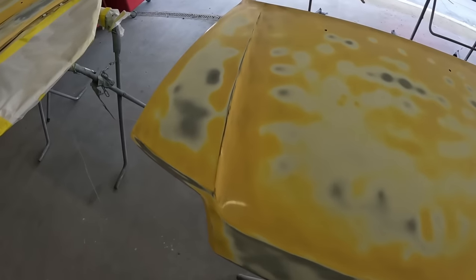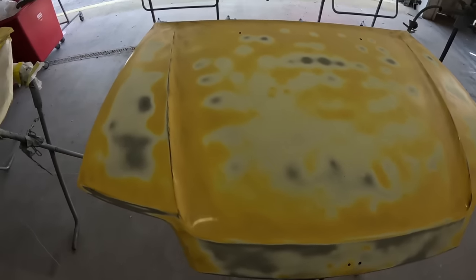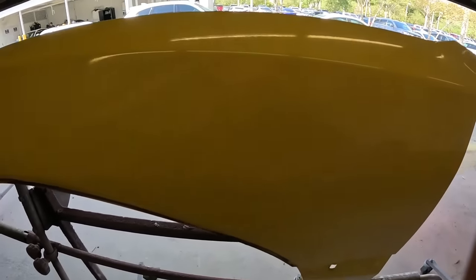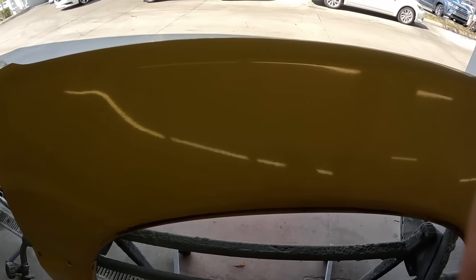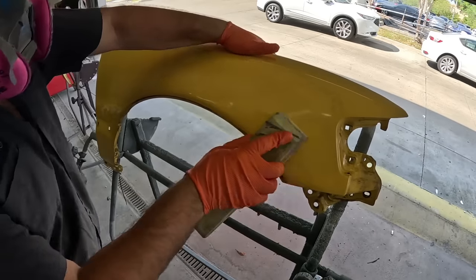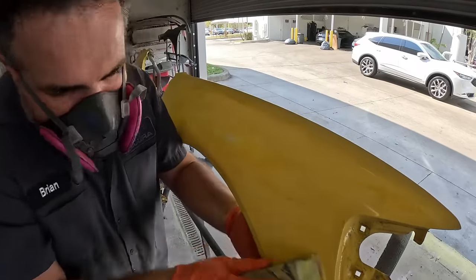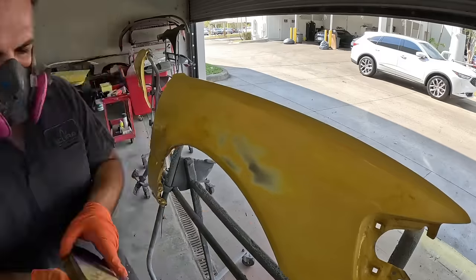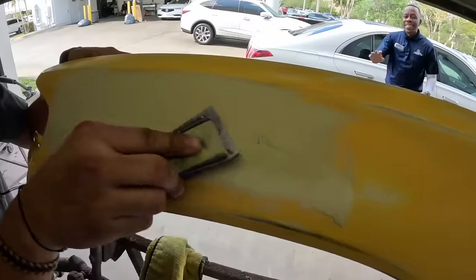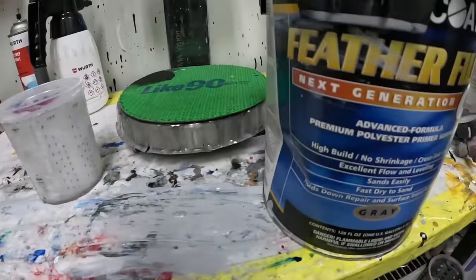Now we follow the same process on the hood. You can see a lot of sanding was needed, and these are older cars, so you will need to get that block out. You'll find that we rarely are using the DA sander unless we're doing the refinement for paint. And every single panel on this vehicle is getting the full service, the full blocking out initially. We'll identify the spots of concern that might need a little bit of filler or some metal work. This is the best way to handle any restoration, is by getting the block out and seeing what is going on first before you start to do any body work,